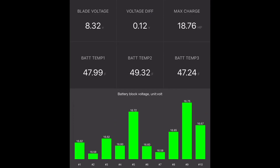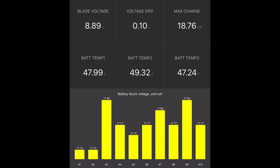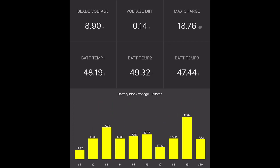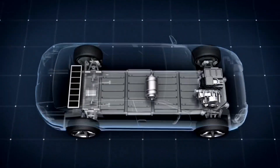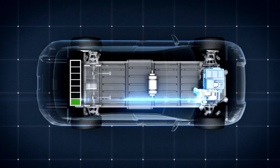Alright, so we got the Gen 4 cells in the battery pack of this Prius C. This is an older Prius, so we're testing everything out — battery fluctuation looks good. It's a great way for your batteries to last a lifetime, just replace them with a newer gen because they're brand new. I'm going to show you guys the chart that we read the cells with and show you the health of the cells and how they're doing. As you can see, the voltage difference is only about 0.1 off, which is really good, and each cell is averaged at 8.5 volts. In my opinion, this is what I would do instead of buying a new hybrid battery pack, because Gen 4 hybrid batteries seem to last a lot longer and I haven't seen many problems with them yet.